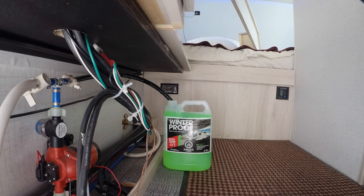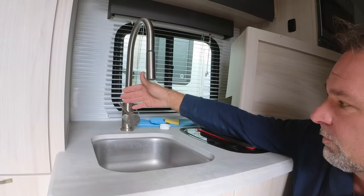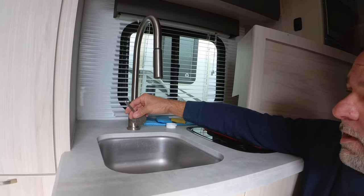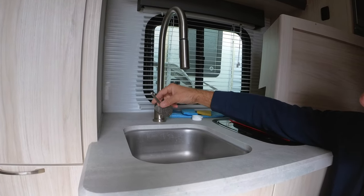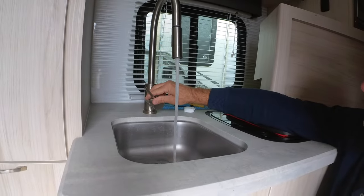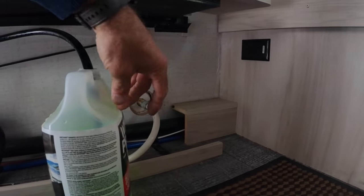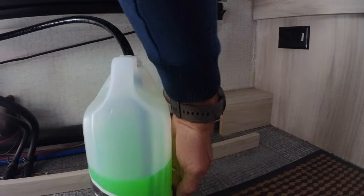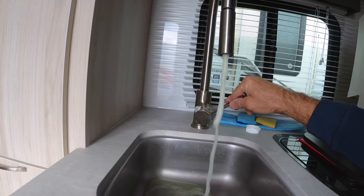Place your jug and fit the hose into it — it's a little tight area. Get the hose right to the bottom of the jug. This way I have the hose right on the bottom and I will turn on the pump and start flushing the system. We will start with the closest tap to the pump, which is the sink. Your trailer might be different but you have to start with the closest one. Then move to the outside shower, then the bathroom. Turn it on and wait for the green antifreeze water.